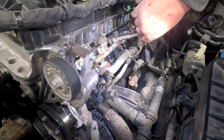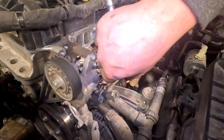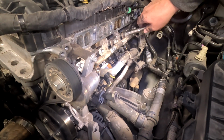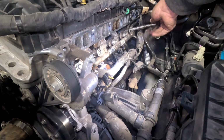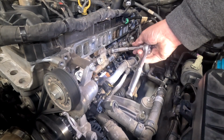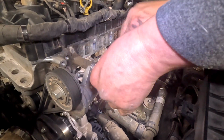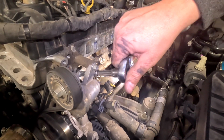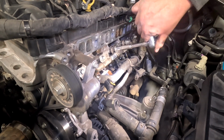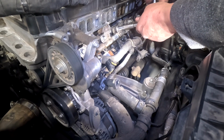Now I'm going to go like this, hold it on the very tip, go 1, 2, outside, and sort of, it will loosen up in the middle ones. So you're just going to do like half a turn on each, and you're not going to try to torque anything right away. Just keep going like this. If it's loose, spin it by hand, then do 1, 2 like that. Next one, 1, 2 like that. Spin it by hand, 1, 2. Now that they're all snug and they're not loosening anymore, just give it a little oomph.